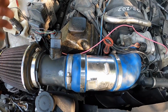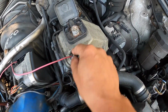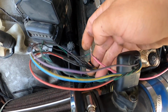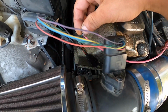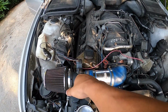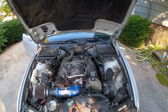It was actually showing power on the ground wire. So for the time being, I rigged up this little temporary ground just here off the valve cover. And yeah, I don't even got it taped to nothing. It's just ground, it's not power. And I tapped into my ground wire for my mass air sensor. When I did this, I immediately lost the voltage that was in that line, and I had a ground. Well, I thought, well, gee, maybe I fixed it.